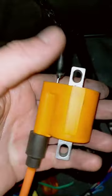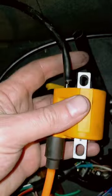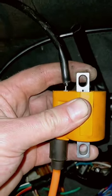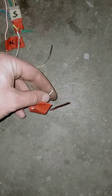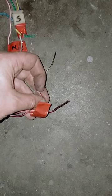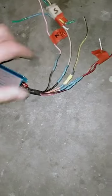The earth for that is this. As I said earlier, it's DC negative, so the large amount of voltage you're generating through here — all of the electrons for that are getting sucked in through the earth, which is the mounting bracket as well. If you don't mount your bracket straight onto bare metal, it probably won't work. The next part for the CDI is your positive and negative. I believe that is black and white for positive, and black and red is earth. One of these is going to go to your power circuit, so when you energize the circuit by turning your key on, you put power onto here, it turns on your little red light and makes this work. Some CDIs draw all of their power from the stator; this one doesn't.